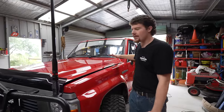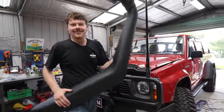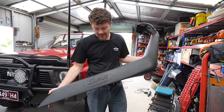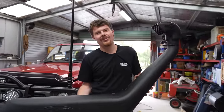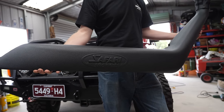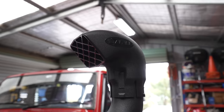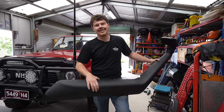There's a fair bit of space that gets taken up by your air filter and it tucks quite neatly into this corner. I want to keep that space free to run a compressor or something like that. So this is what we've decided to run — a brand spanking new Safari V-Spec that we got from the guys at OCAM. The old Safari ones are much smaller, definitely old school — these ones are way bigger, fit the guard a lot nicer, look a lot nicer, and have a hell of a lot more airflow. This should keep up with the airflow of any three inch stano. Let's get started.